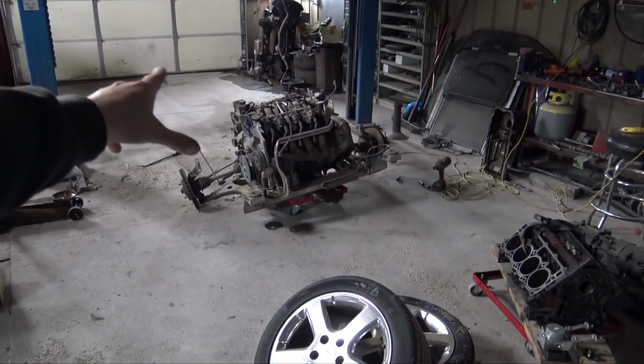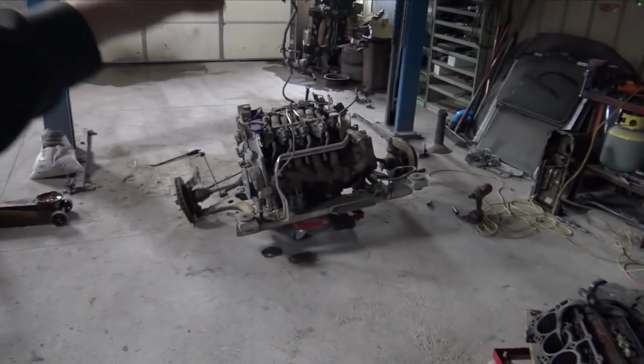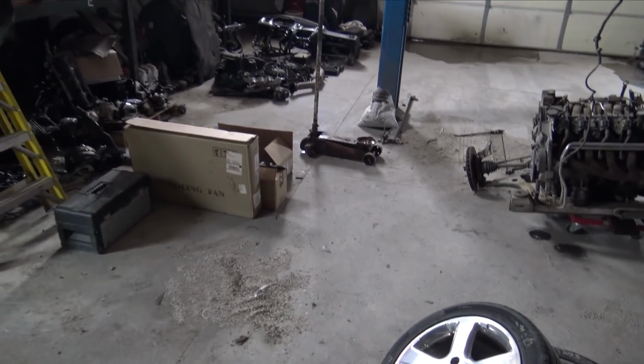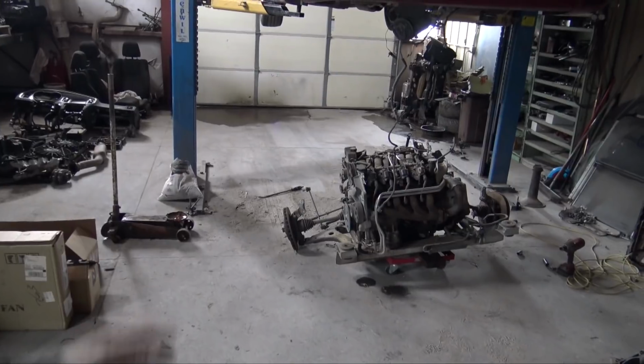So in the next video, I'll be tearing that down. I'm gonna pull the heads, since it did come with head gaskets, so I can check to make sure there isn't scoring on the cylinder walls or any issues. He said it did have a misfire, and these come with the cylinder on demand, and misfires are commonly caused by that system. So that's why all the delete stuff's here. He never ended up putting any of that stuff in the engine. He just dropped it out.